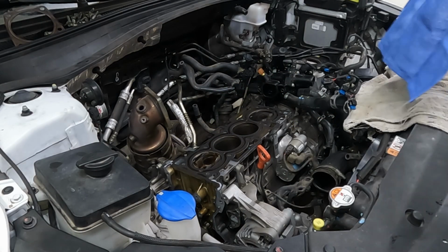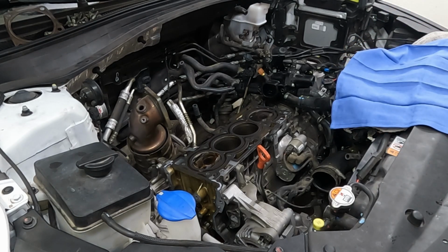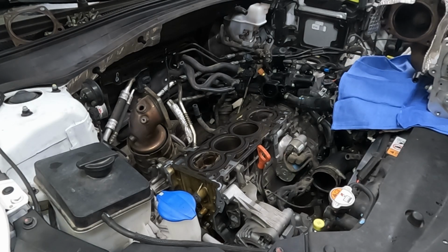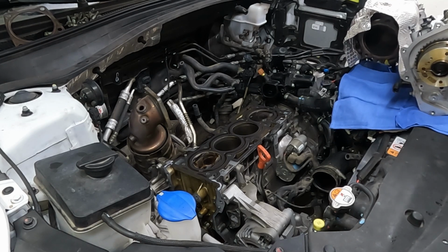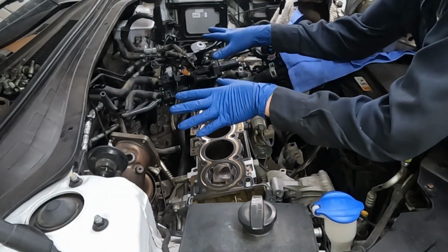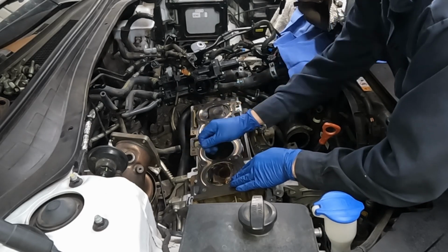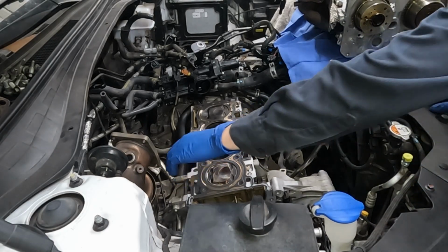I'm just going to drape some lint-free rags over here, because I know I'm going to have to set the head down at least once. Here we go. Oh my gosh. All right, now I'm just taking one more peek at the underside of my head just to make sure it is nice and free of any lint or debris. Okay. Now let me get inside. Let me move you just a little. All right, the trick when setting this down is to try to set it directly down. We don't want any sliding around, if at all possible, because we don't want this dowel to scratch our head surface. Okay, so let me crawl inside.